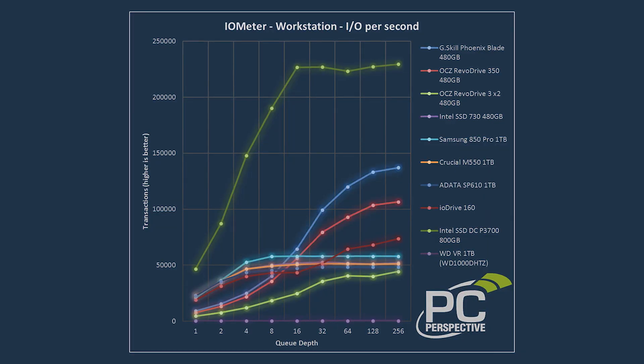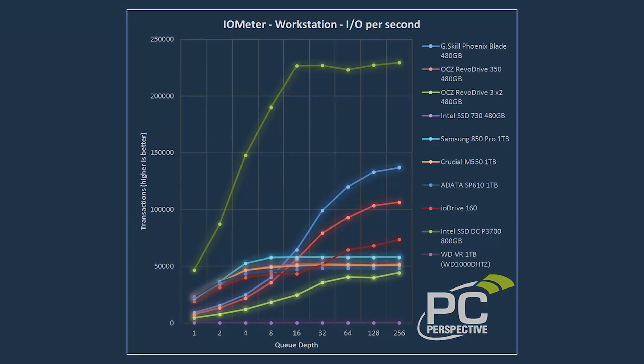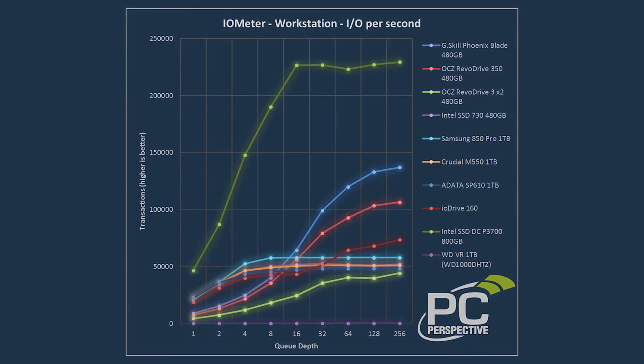For a person just using this day to day in a random IO workload, any kind of randomness at all — this unit doesn't surpass the newer single SSDs, not even a RAID of them, but just a single 850 — talking about SATA SSDs. It doesn't really pass them until you get past a queue depth of eight.